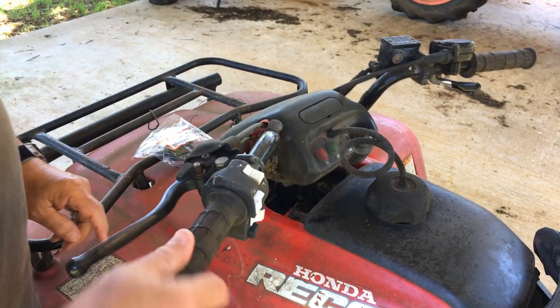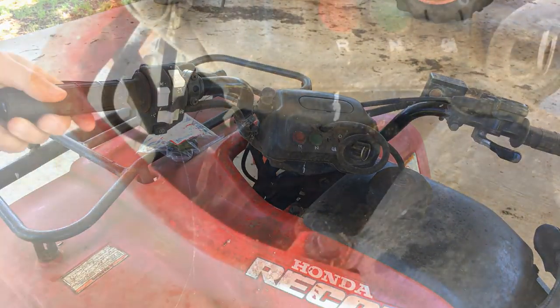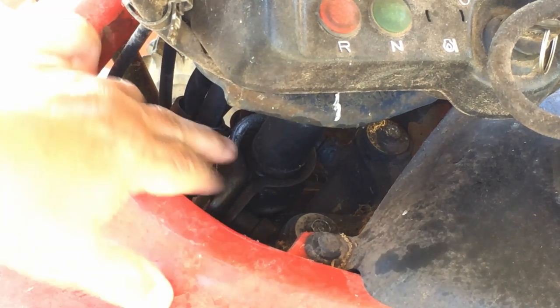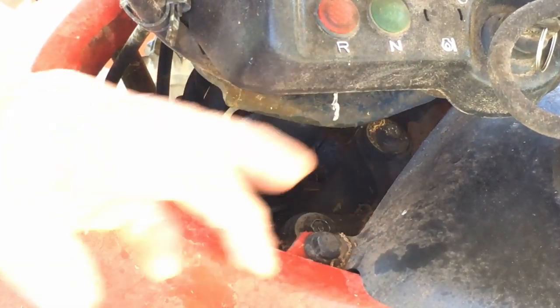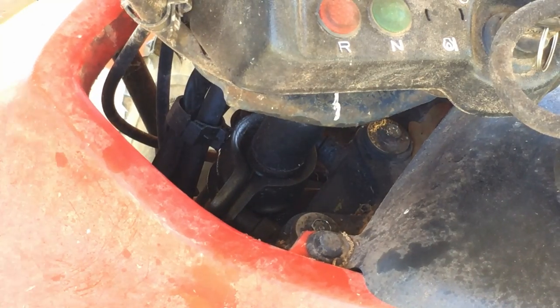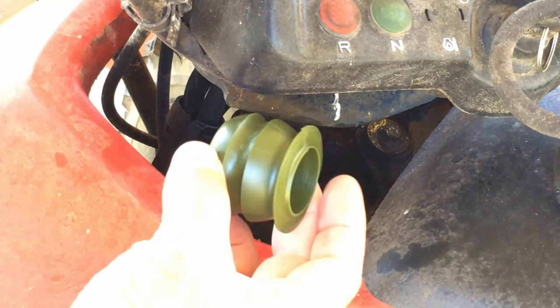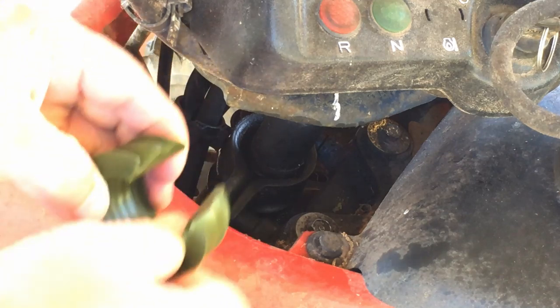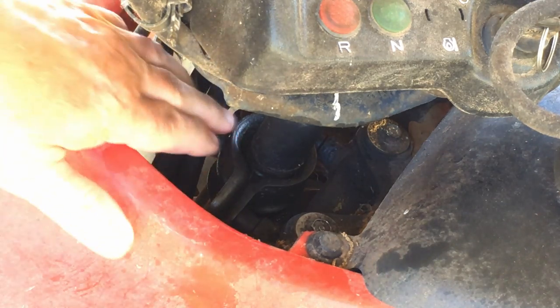Here's the part — I'll show you that in just a minute and we're going to fix it. Let's look down in there for a better look. Here it is — it's a round kind of clamp that has bolts on both sides, which clamps the bushing down in there. Here's the bushing, and it is split, which makes it a lot easier to get in there.